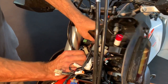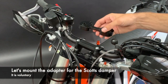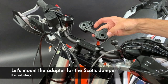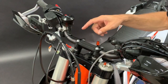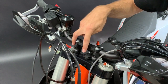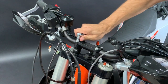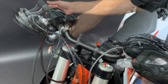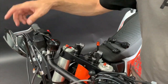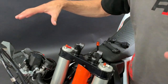Now we will mount the handlebar risers and also the gauge for the Scott damper. To do this we need to remove the handlebars and the handlebar clamps. Start releasing the handlebar bolts, carefully remove the handlebars, and secure them so they don't fall down.